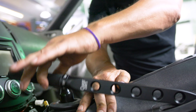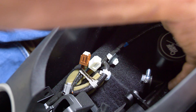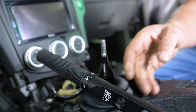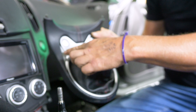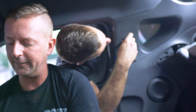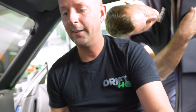We have just test-fit the Chase Bays in here with the bracket and I got it on the first try. Really impressed with that one. Everything fits back where it's supposed to, hydro goes up and down. We're going to put a little shim on the back bolt because the master cylinder gets close to the trans tunnel — it's almost touching. The nut-and-bolt job has about a quarter inch of gap, so between that and the trans tunnel there's about an inch of gap on the back bolt. On the last 350Z we did, it was the ASD hydro — you notch out a piece of plastic and it comes up through there. This 370Z center console is leather-wrapped with your controls, so you can't cut a hole through it. The pull-up hydro works really well, especially on a street car — it doesn't get in the way but it still looks cool.